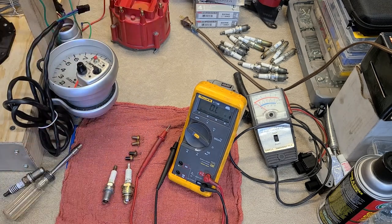For a race car you want a low resistance spark plug wire and a low or no resistance spark plug to get maximum spark energy. On a street car you'll run a 5,000-plus ohm resistant spark plug plus a very high resistance factory wire — that's fine for the street. But for a race car you want the most spark energy you can possibly get.